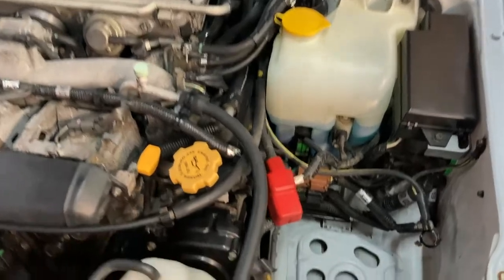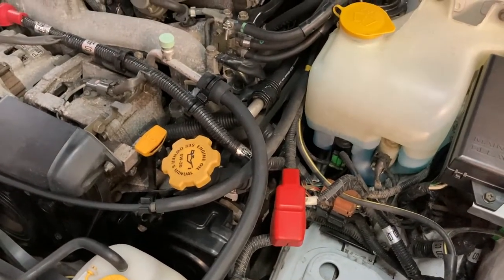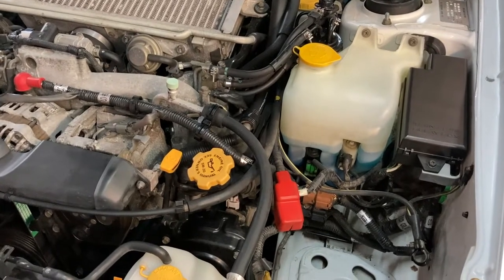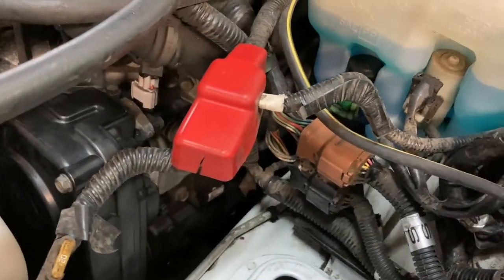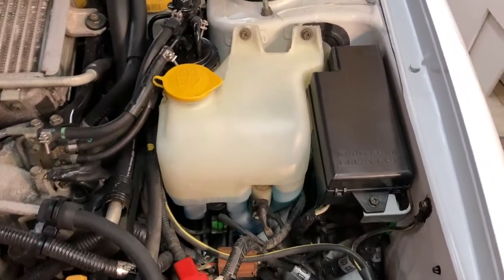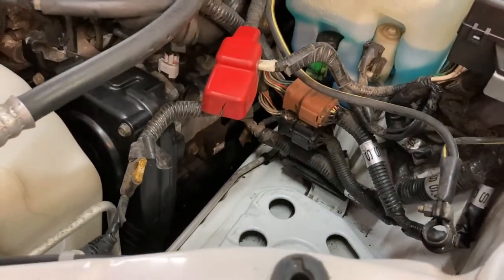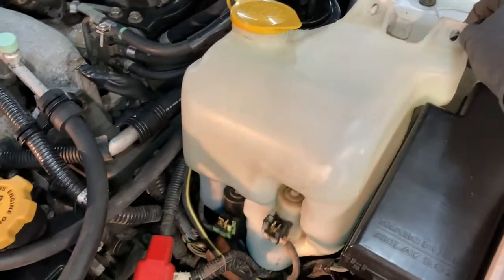The first thing we're going to have to do is make more room than just removing the battery. I believe you can replace these without jacking up one side of the engine — it gives you a little more room, but I believe you can do this by just making a little bit of room in the engine bay and you should be able to get to everything on the side of the valve cover. I'm going to start with the driver's side first. The first step is going to be to remove this reservoir and unbolt the fuse box so we can push it out of the way.